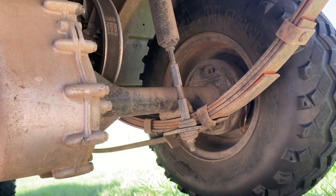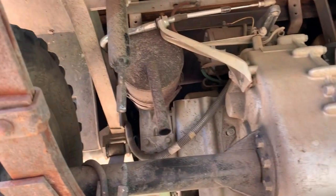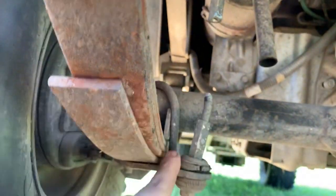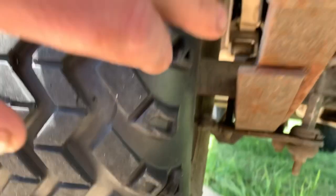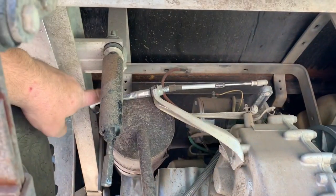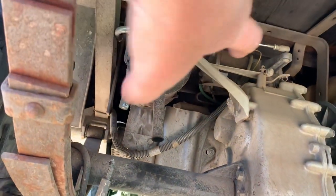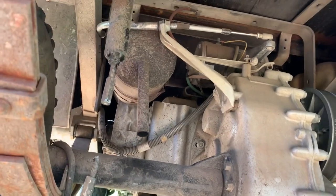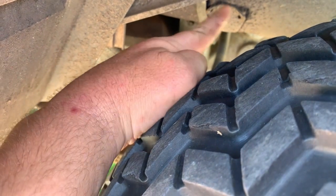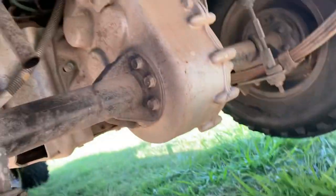That flat is the least of their worries on this cart. It looks pretty normal on one side, but over here — look at this shock, it's just completely broken and busted. It's supposed to mount here, but the shock mount is actually bent. The rear leaf spring is broken and bent. The shift cable up here is all mangled and the muffler has been pushed back. Something got in here and just broke the shock and pushed the muffler back. You can tell by the muffler hold-down strap — it's supposed to sit inside this little saddle and it's just been mangled and pushed back.